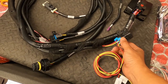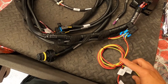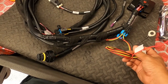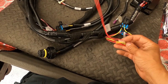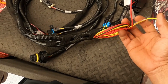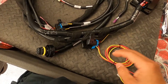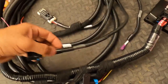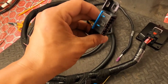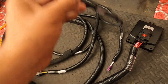You're going to have a few little fuse boxes here with a couple leads. You're going to have a positive, a negative which is the ground, and then a positive switch which is like an ignition hot. You want ignition hot power and ground — that's it, simple. Connect those up. I'm only going to talk about the ones we need, the ones we're actually going to use. Obviously the OBD2 port — you're going to need that, mount that wherever you want in your dash.